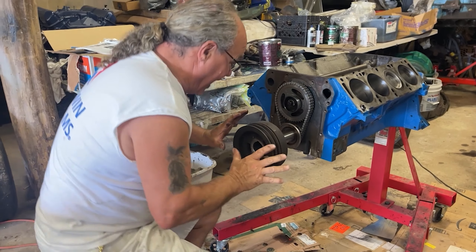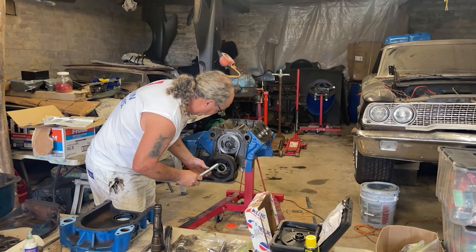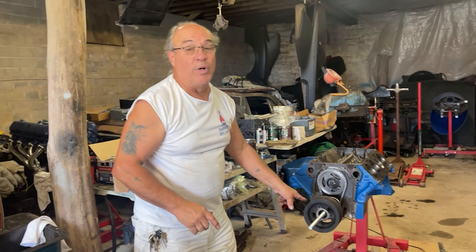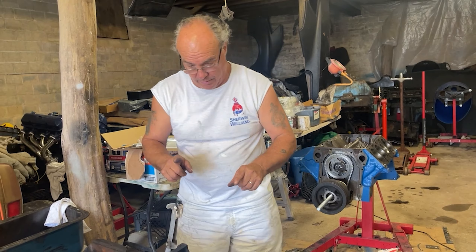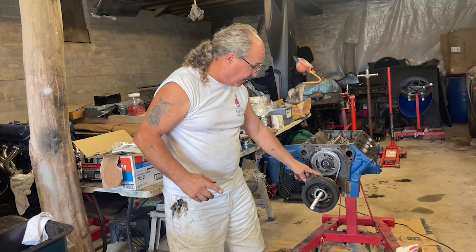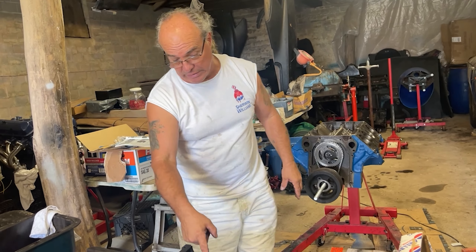That is as far as it goes on. With that short bolt they give you, it's not enough — you've gotta be able to get all the way in there and tighten it up the right way. I'm going to put the cover on first. The idea is when you put the cover on, the seal — you have to make sure you put it on and move it. Because if you don't check it and make sure this is centered when you put this on, you are in trouble. It'll lean too far on one side or the other and it will leak immediately. You'll have a front seal leak. No good.